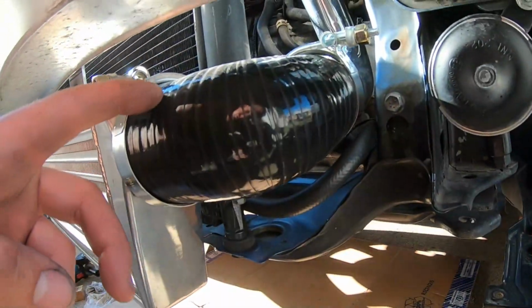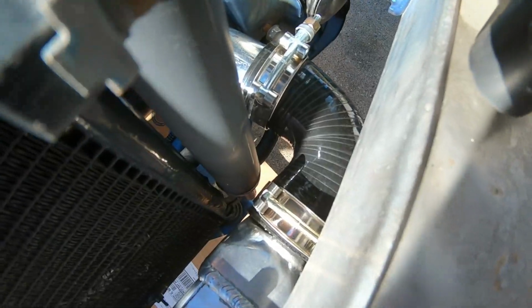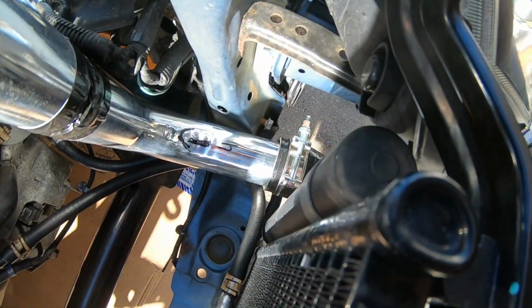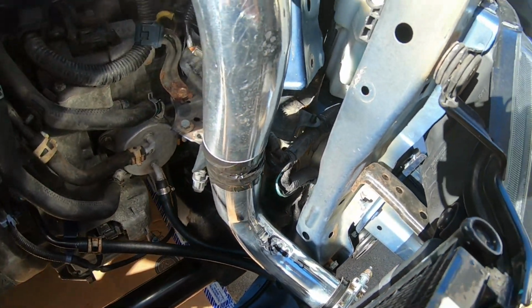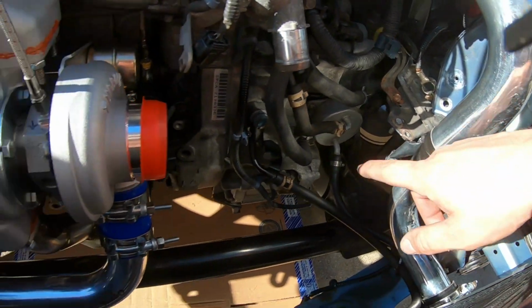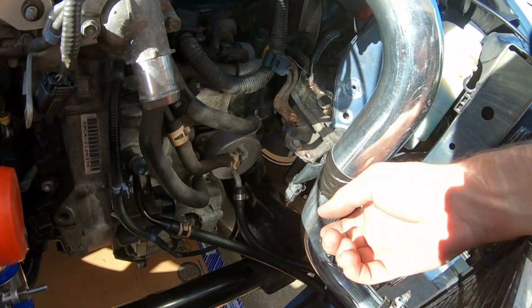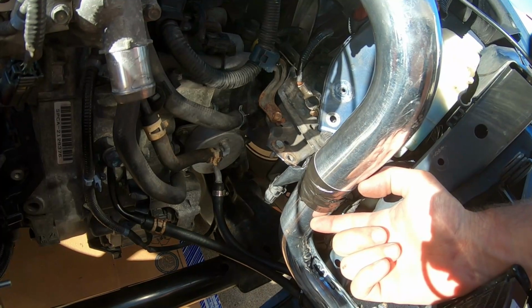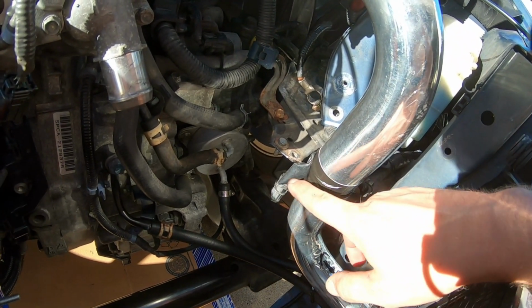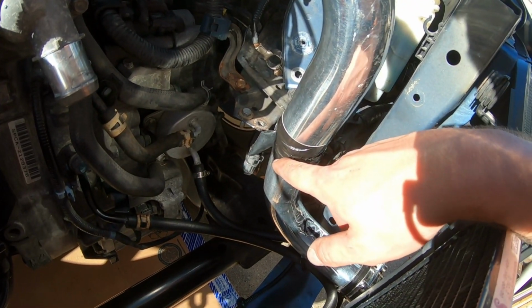It goes through the intercooler, cools the charge, and there's another 2.5 to 2 inch 90 right there. You can see that. And that's going to another pipe. Right now I got this duct tape again because I'm missing just straight couplers like this. So either I'm gonna buy another 2 inch coupler here, or maybe weld it. Probably the coupler right now, just to get everything done, and then weld it in the future.